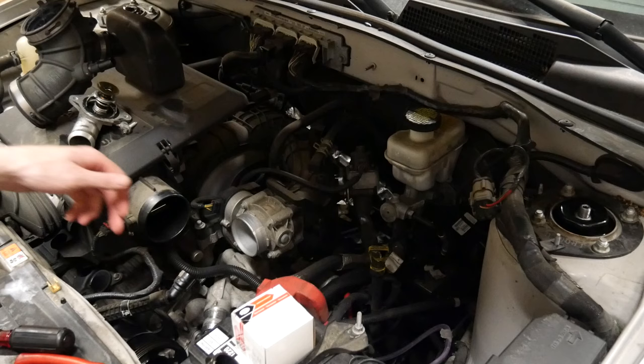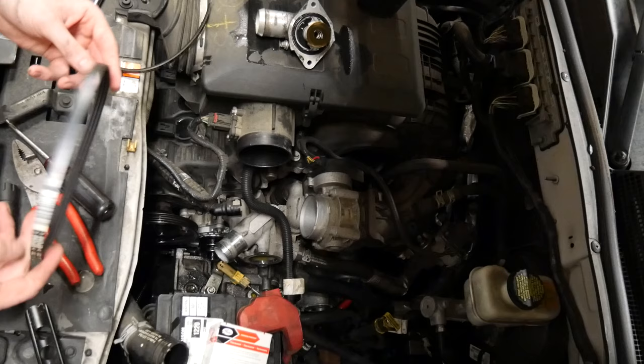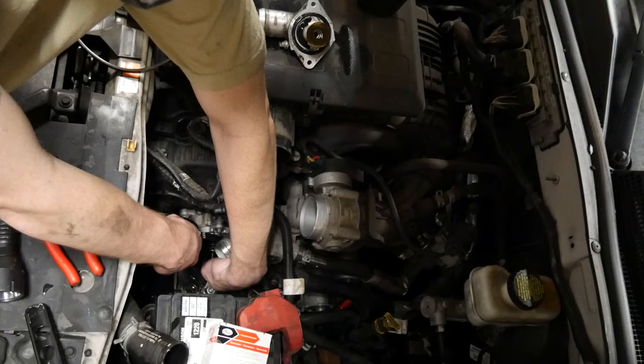On the back of this engine, we have the camshaft jack pulley and water pump. To install the belt, determine which way the drive pulley rotates and loop the belt over the pulley with the deepest shoulder. In this application, that would be the water pump. Since the camshaft pulley rotates counter clockwise, I'm going to start the belt on the side of the camshaft pulley that turns away from the water pump.